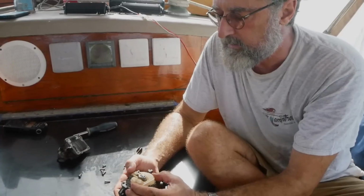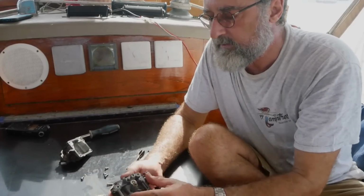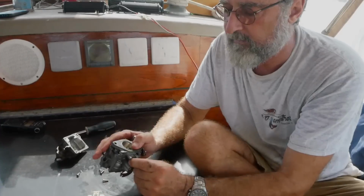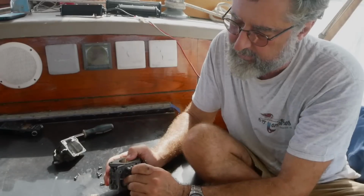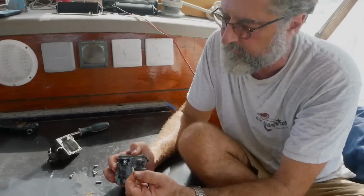All it really does is go up and down, and it levers this little thing. This is just a little valve, and when it's pushed down, no fuel can flow, and when it's lifted up, fuel can flow. So when the float says more fuel, the little valve comes out, squirts more fuel. As soon as there's enough fuel, it goes in, and it just keeps playing that game, holding the fuel right at the level it should be.